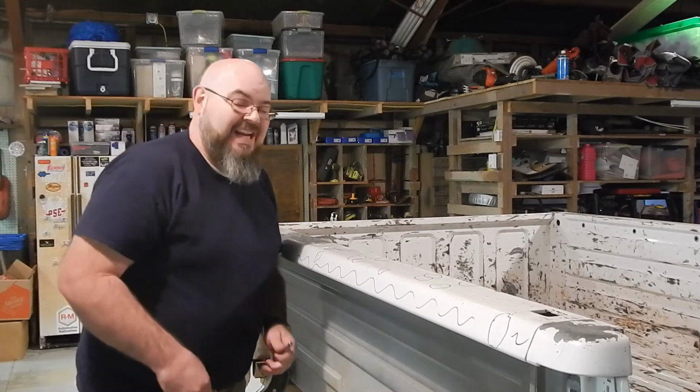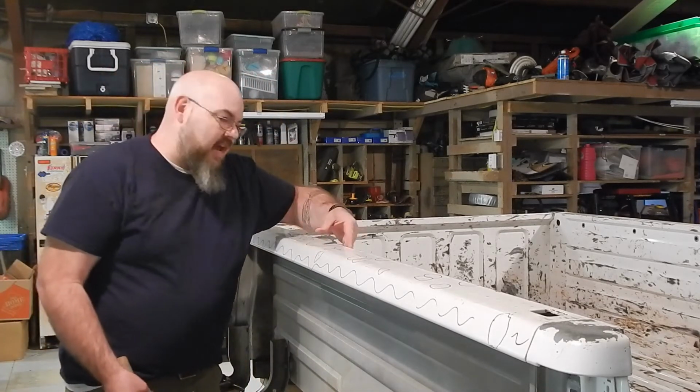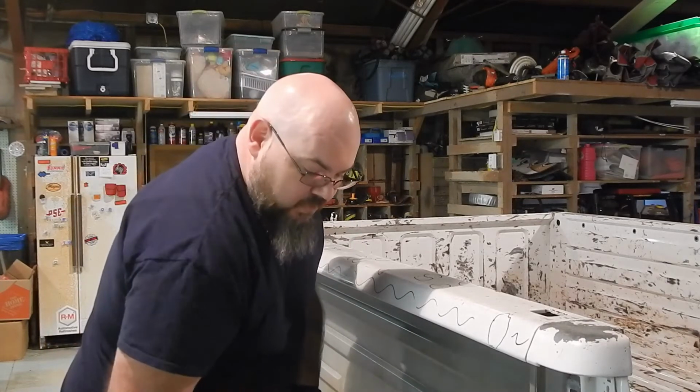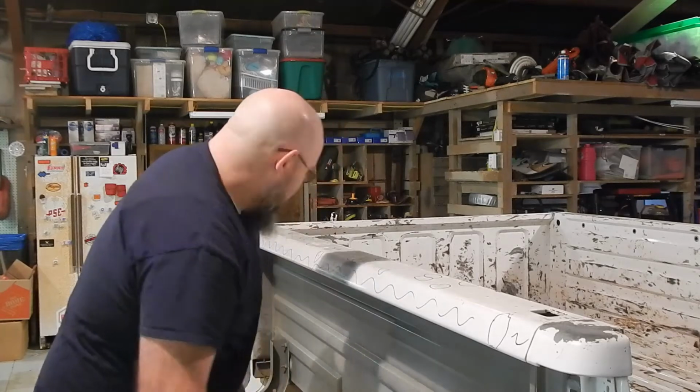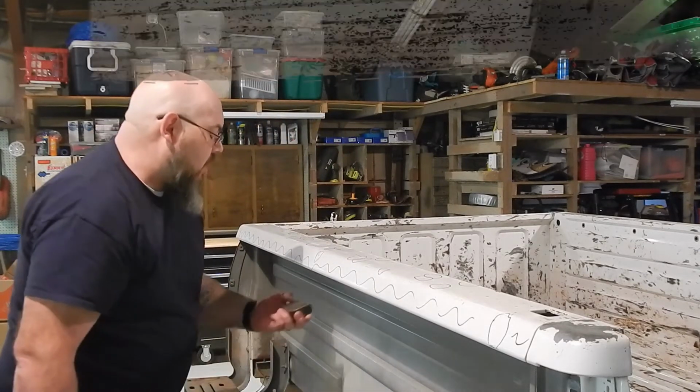Tell you what, guys, that did a lot of good. I mean, honestly, I could run a grinder over that, put filler in it, and I'm not going to feel bad. But we're not going to go quite that far yet. We can finish it out with just a little bit of hammer and dolly work.